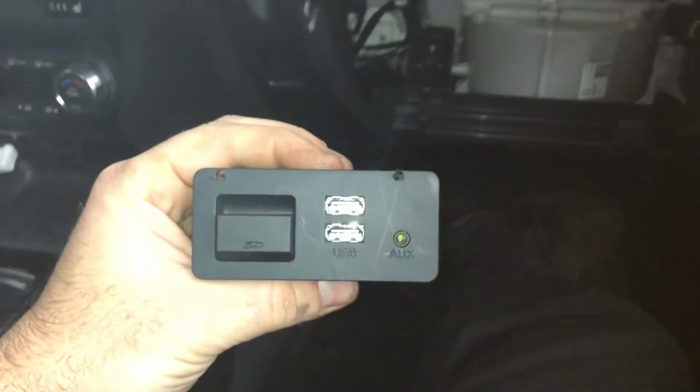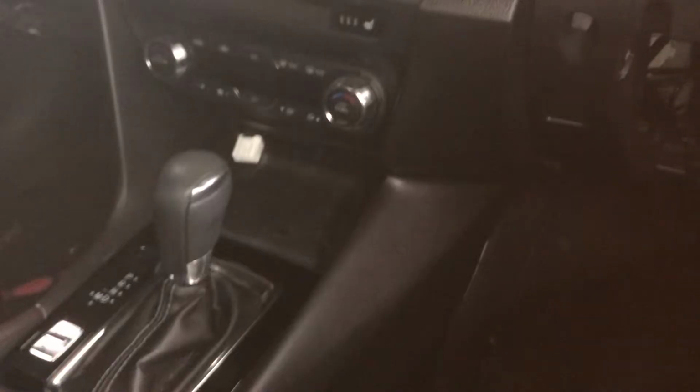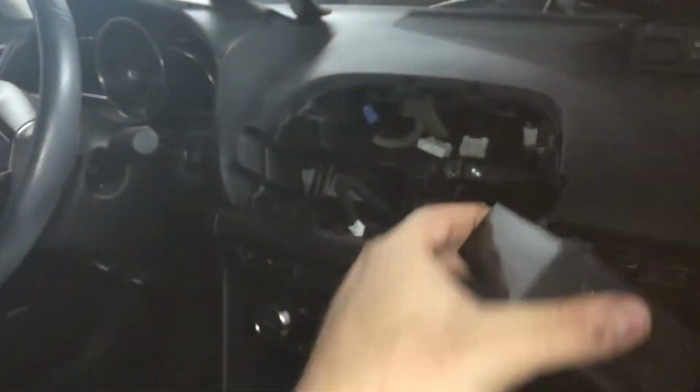I didn't try it on the bottom here because it was just a test one. So I said, you know what? I'm going to give it a shot. I have a pretty steady hand. So this is the one that did belong in this car, and you'll see down there that it's not in the car anymore. And sure enough, the entire center console has been untouched. Like I said, I just removed the trim piece up here, the glove box, the screen, and then there's one trim piece down there, the little kick panel area, that also pops off, no tools required.